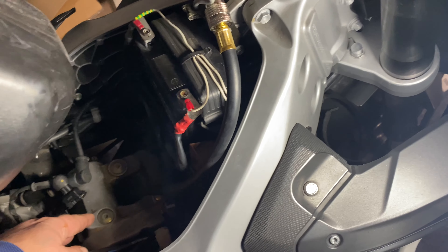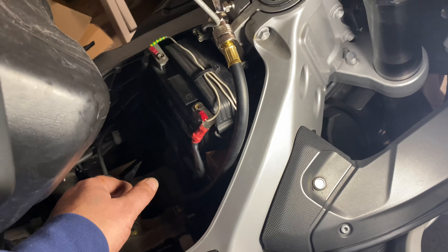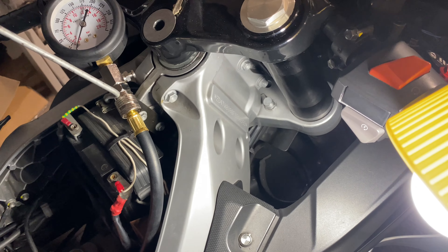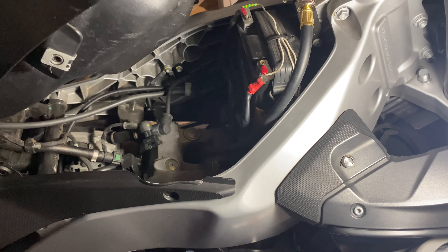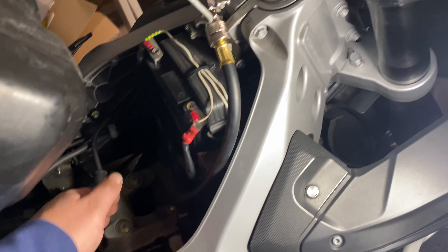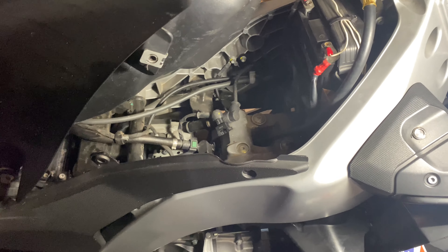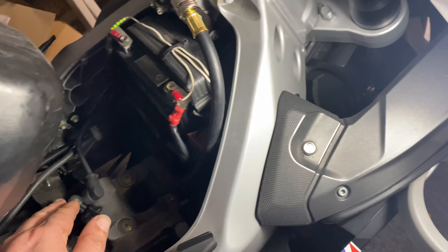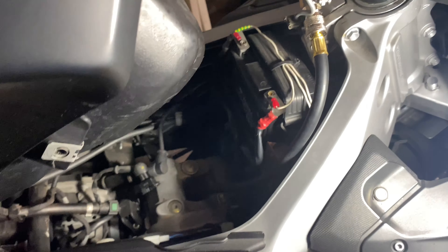It's quite hard to explain without going into too much detail, but you can also do a pressure test with a compressor. Put around 100 PSI through there — if you can hear air coming out your exhaust, your exhaust valve is leaking. If you hear air coming out your airbox, your intake valve is leaking. If you hear air coming out your crankcase, it's the piston rings.